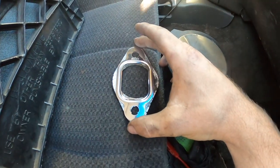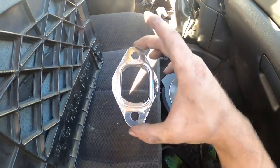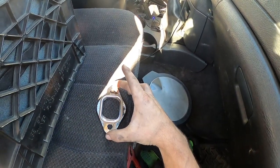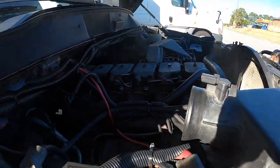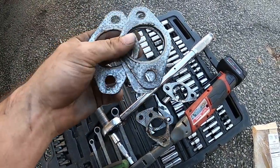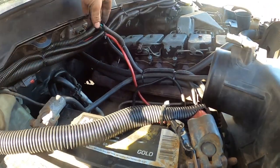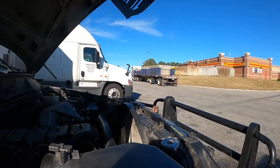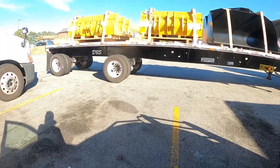Here's the difference between a common rail gasket — circle — and a 12-valve gasket — square. When you line them up you can see it will still somewhat cover that area and hopefully seal correctly. Everyone's saying it will. Here are the old ones — you can see they leak out of each side. If you're doing a common rail manifold on a 12-valve, don't use the common rail gaskets. I torqued everything down to 37 foot-pounds as specified. Let's get it started and see if she leaks.